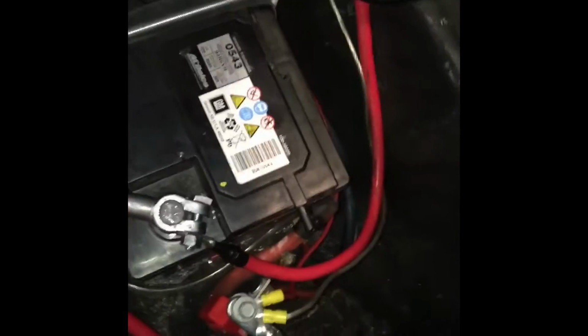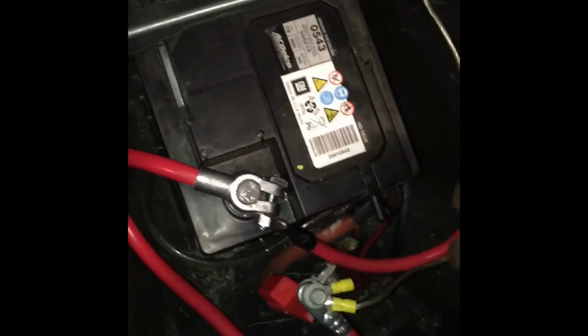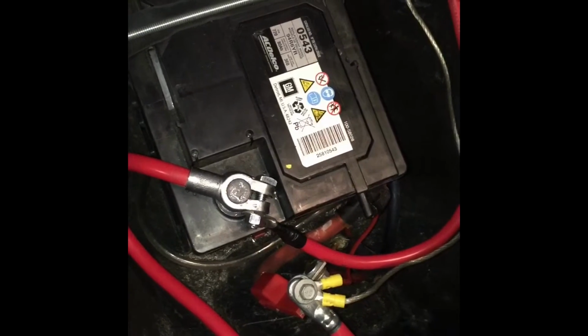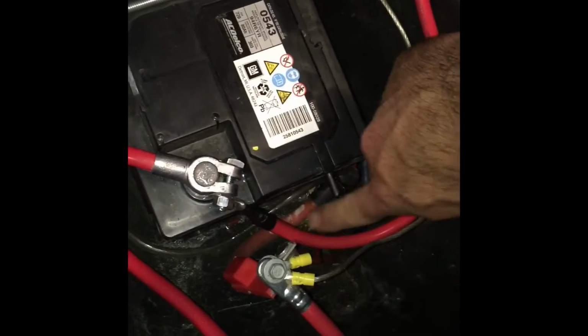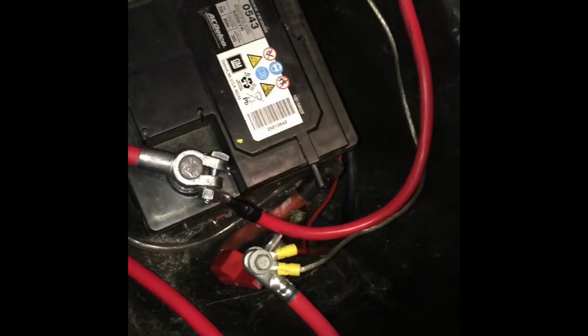So I did that, and then I tried it, and if you know anything about these, you gotta also kill the alternator, because when I killed it, the alternator kept it powered up and running. So that's what this other wire is coming in here to the positive, is off the alternator. Yeah, it's 1-gauge or 2-gauge from the alternator back with an inline fuse, just like you would on your stereo system, I guess. I just ran it under the back seat with the rest of the wires. That's the power wire. You want to make sure you're not pinching it anywhere. There's the fuse in there.